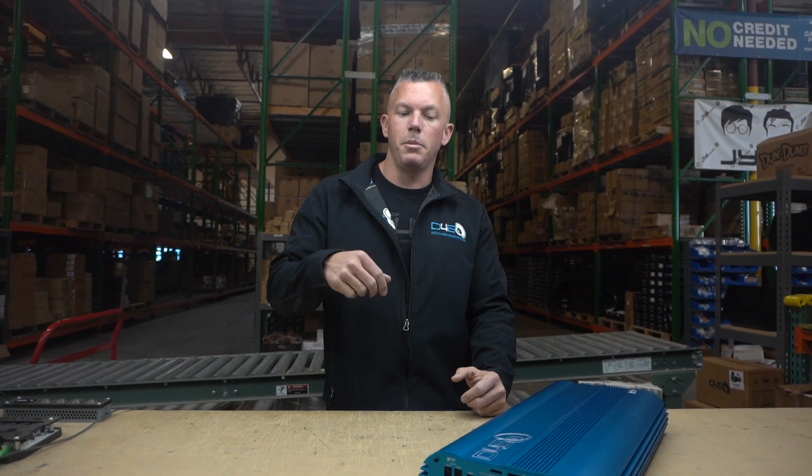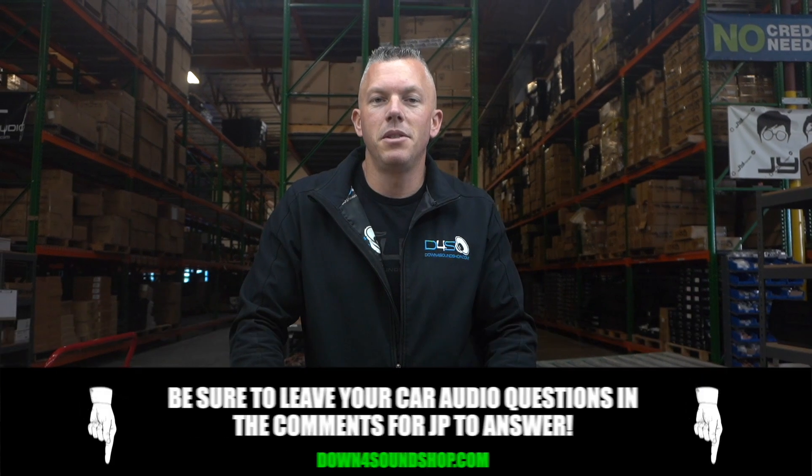You want to respect the gain, because you can cause your amplifier to fail or your speakers to fail prematurely if you get too crazy with it. If you've turned it up a decent amount and it's still not pushing your subs like you want, you probably don't have a big enough amplifier — you're trying to get too much out of something that's too small.